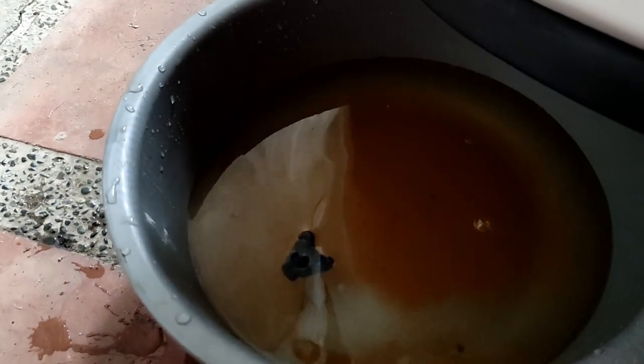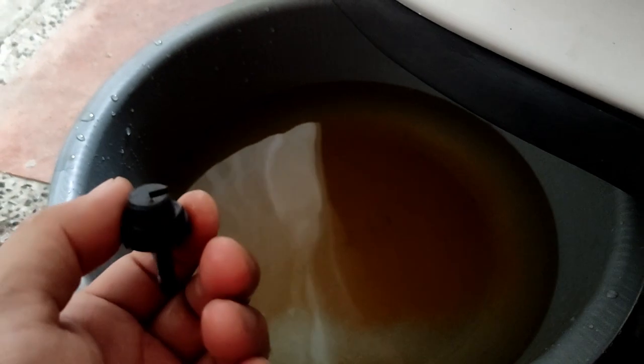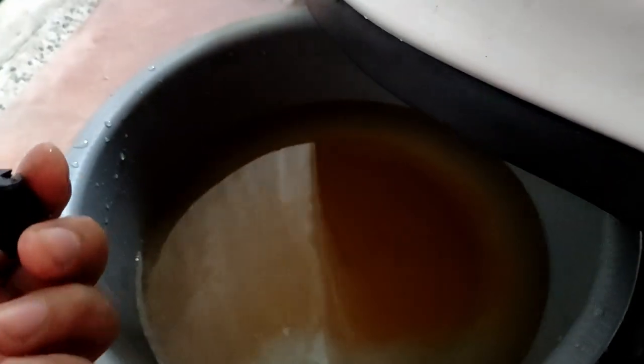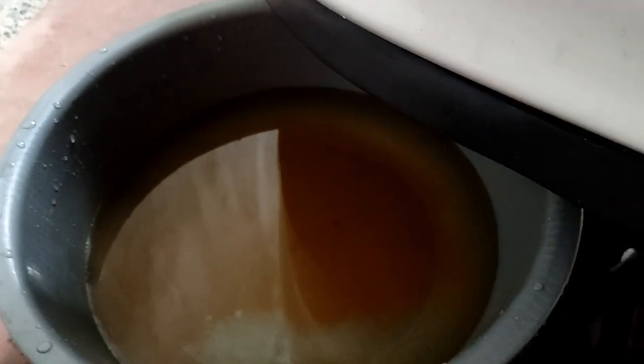of distilled water and then use 1 or 2 liters of coolant and then flush it out and then finally use the Honda green coolant. I'm gonna start from step one, plug this back on the rad and add some distilled water, start the engine for about a minute, let it cycle, and then add some more distilled water and bada boom. Let's see what will happen on our little experiment.